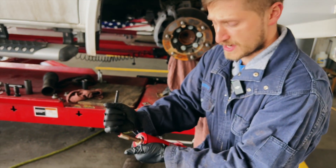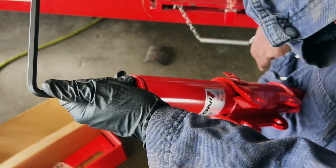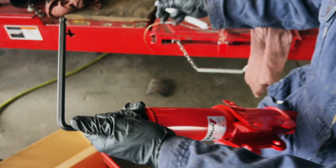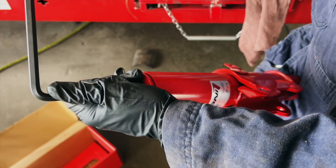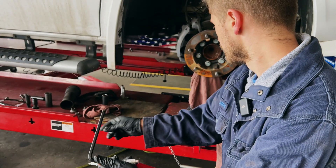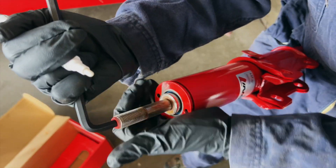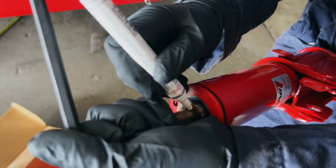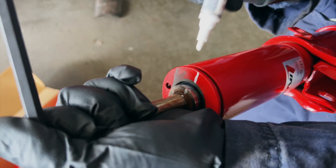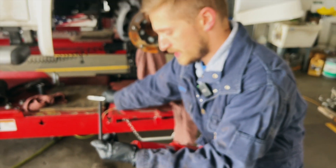So now I've got my point where it's backed all the way off. I'm going to use a paint stick just as a reference. These struts are a little bit different in that there is just a little bit of pressure in them, so it does kind of want to expand. Not like a monotube gas strut would, but there is a little bit there, so you really do have to keep a little bit of pressure on it to keep those cams engaged. I'm going to make a little mark right there — one mark on the shaft of the strut and one mark on the body of the lower half. That gives me my reference point for fully loose.